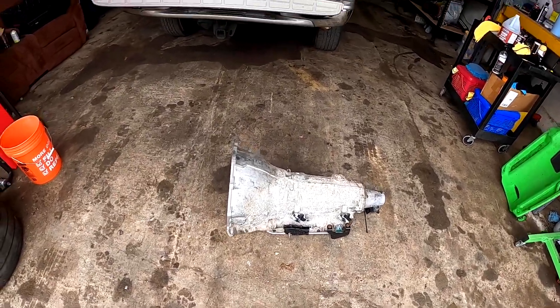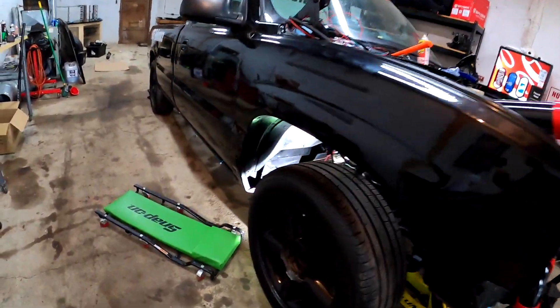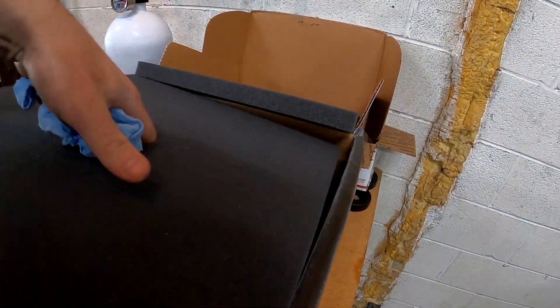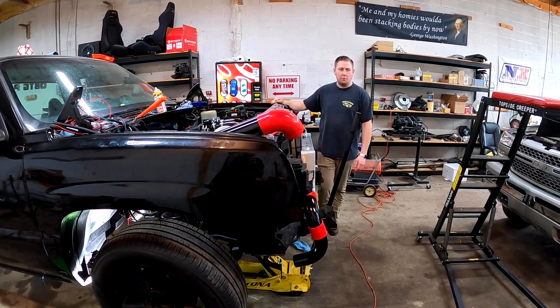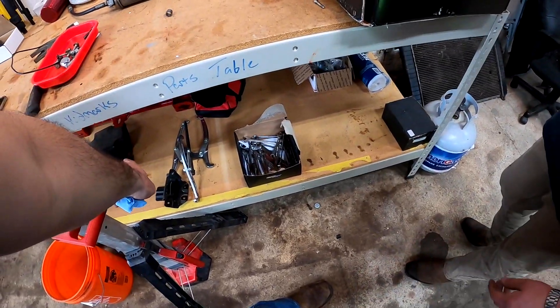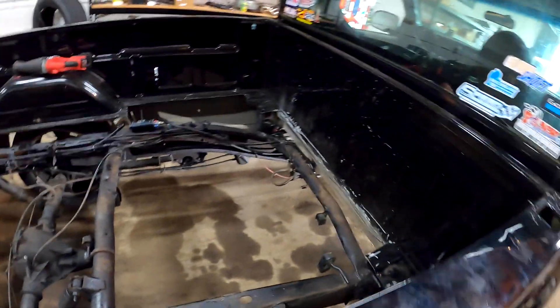Well, there she is, boys. Skid Mark's 4L80E. Trying to keep faced away from outside there because that's in the next video. But today, we are putting the 4L80E back in Skid Mark. We got our good old Circle D converter here. I've got to pull this thing out, put some fluid in her, and get her put up in that 4L80E. That's the 3200-3400 stall converter. Trying to figure out what part of the shop we put the trans in and find the bolts. Skid is really coming along. The next step, now that we got this back, is to get this trans in, get the driveshaft in, and finish hooking up the Holley. Today's goal is to put the trans in - whole drive line. I just realized the driveshaft isn't going in today - it's missing a cap.